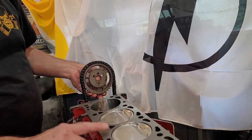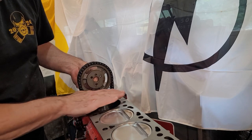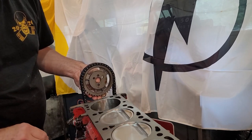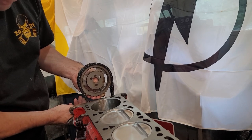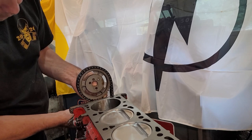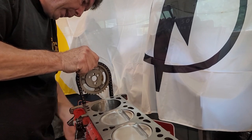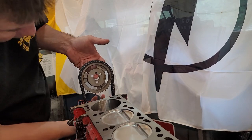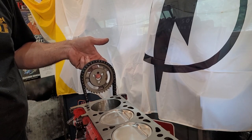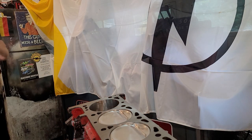With the tolerance stack differences, I wanted to point out one more thing. When you have your cam in your head, the distance between the center of the cam and the chain and the pistons is going to drop just a little bit. When it drops, that means the chain will move a little bit one way or the other, and that's going to change your location of your pin. All the differences here are very small, but one degree advance can cause you to detonate more — so it will just make the problem that much worse. That's something to consider when making sure you've got everything set up straight.